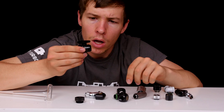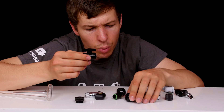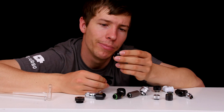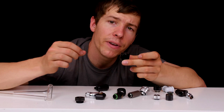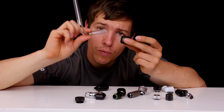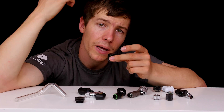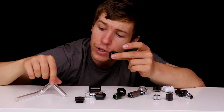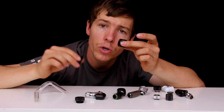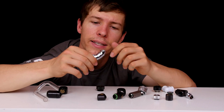To install the drain valve, find a port at the bottom of your reservoir and use a T-join fitting, which has three holes making it easy to route tubing in any direction. Attach one end to the reservoir, route your tubing loop out of one port, and attach the drain valve to the third port. When you cycle the pump with the valve open, some liquid will continue through the loop while a lot drains out through the valve — all due to gravity.